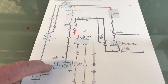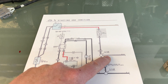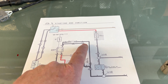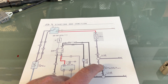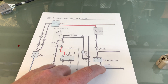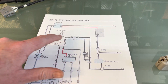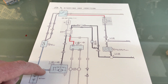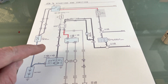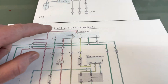So the way the circuit works: you crank the key, it sends 12 volts to NSW irrespective of what gear you're in — park, drive, reverse, whatever. NSW always gets 12 volts because it's prior to the neutral start switch. If you are in park or neutral, the circuit is completed, it sends a signal to STA, triggers the relay, and that relay engages your starter motor.